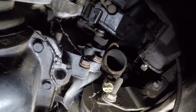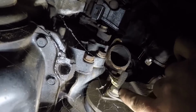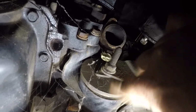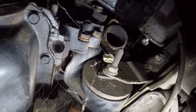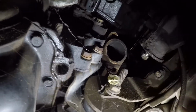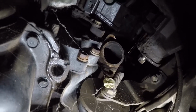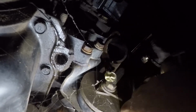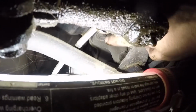Now, it actually doesn't look too bad. This bolt on the motor mount would probably have to be flipped around so that the head is here and the long threads stick out the other end. And you're a little tight on the steering shaft, but it looks like it will clear. So I think you could come out from that manifold, straight around, loop, go to this side.